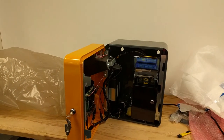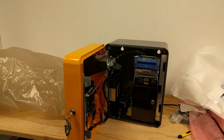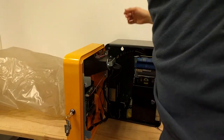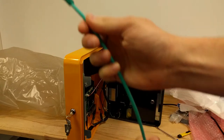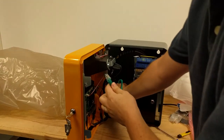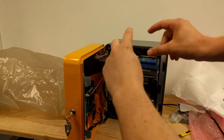Customers ask me about the ethernet connection. The machine can connect via ethernet or via Wi-Fi. Here is the ethernet port. To get it into the machine, there is a small plate you take out, put the cable through the back through the hole, then make a small knot on the cable. This protects the motherboard from pressure if somebody pulls the cable. Then put that metal plate back in, rotated at 90 degrees.